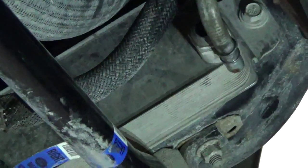And what we'll do here is I've got a piece of tubing. It's 1/2 inch OD. It matches the diameter of this fitting right here. There's an O-ring inside that'll seal on. So you basically just push it in. It'll seal on the outside of that 1/2 inch OD poly tubing. And then from there we can go to a drain pan.